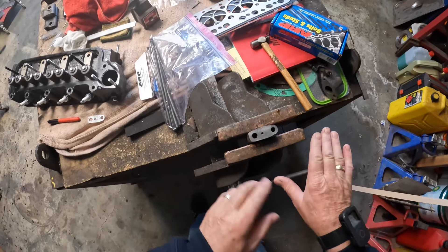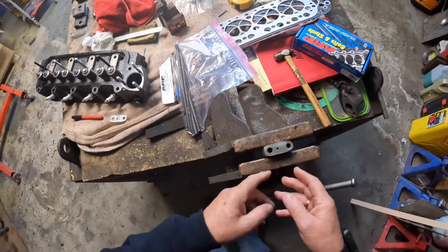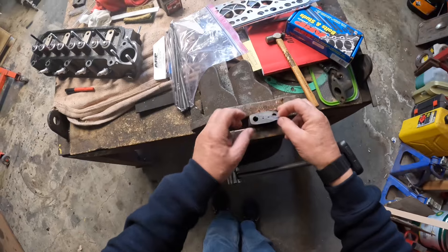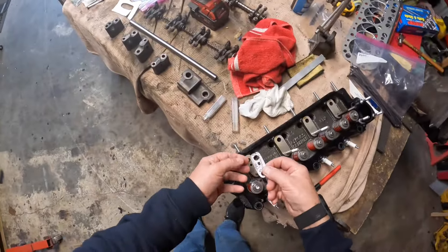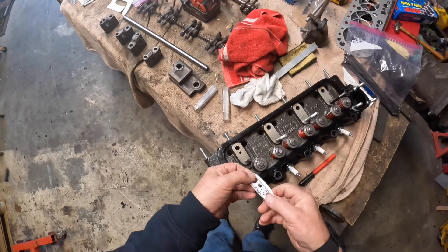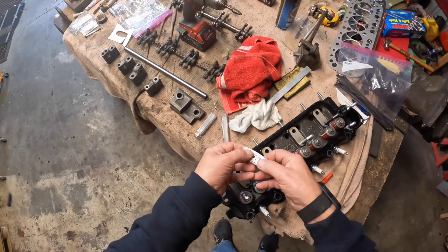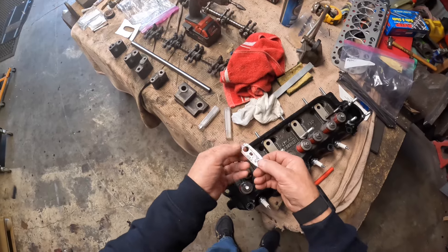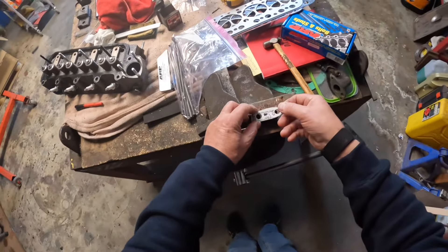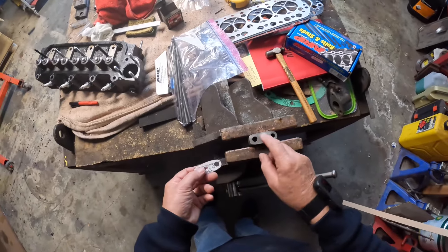Because the surface has been ground, the little recess in the pedestal that aligned to the oil hole has now lost its recess. So I made a little paper template and transferred that onto the cylinder head where the oil port goes. I then checked the alignment of the oil hole on the pedestal to the oil hole on the head and found a little bit of discrepancy — it wants a small amount burred away on that edge.